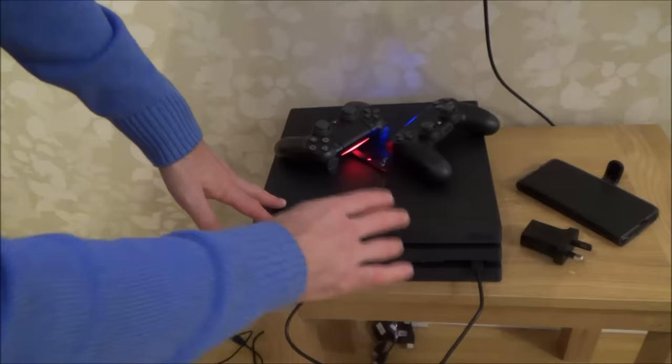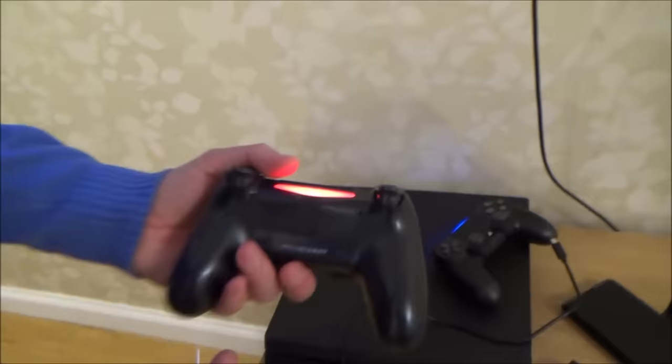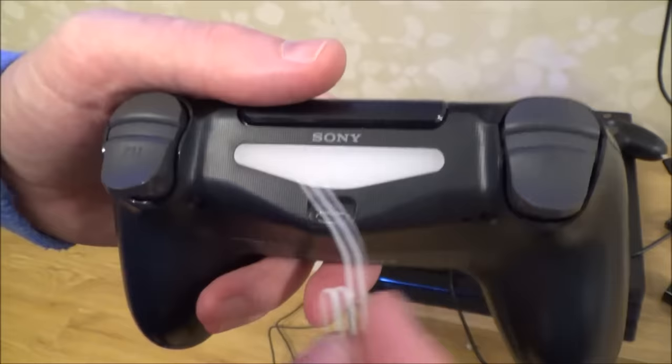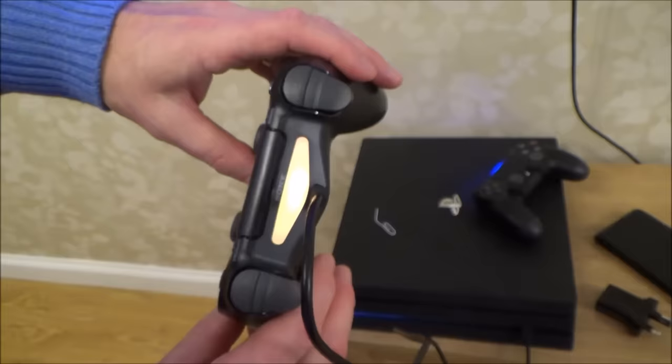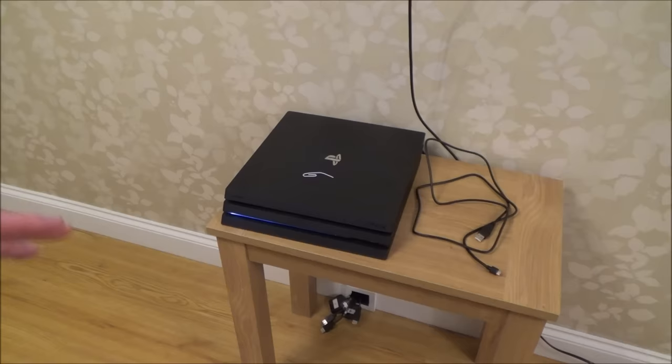If that doesn't work, try another USB port in case your port is playing up. If you've tried two cables and two USB ports and it still doesn't work, I would suggest resetting your controller. If you look closely at the back you will see a little hole — get a paper clip, put it in there and just tap it, and you can see the controller has gone off. Plug your cable in again, you'll see it charging, and try again.